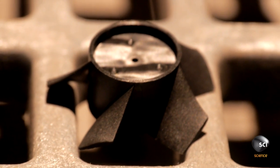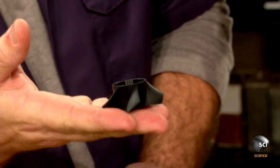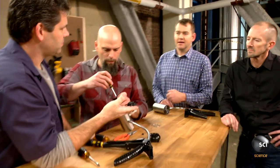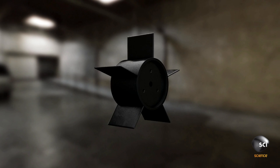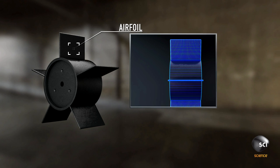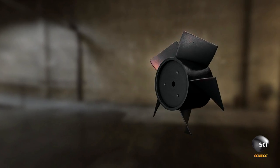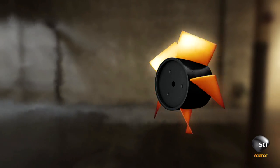Most of the science of this particular product is in this fan. You have a lot of development in this fan. That's correct, and that's because it's battery powered — we had to have a really efficient fan so it would last a long time on a charge. It's an airfoil blade fan. Most standard fans are just a flat square blade and they just push through the air — not very efficient. But they've taken the time to design an airfoil so the blade moves through the air extremely efficiently and does its job really well.